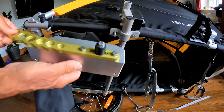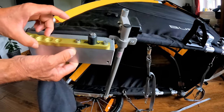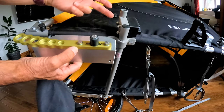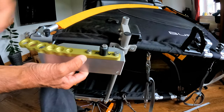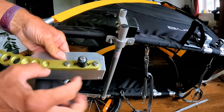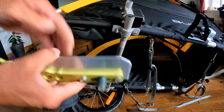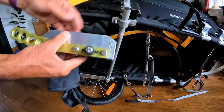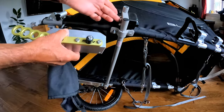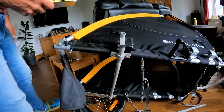We then placed the two units together just roughly by hand and found that this position on the plate works best, and the little bump stop there met the bump stop on the pivoting part, which we'll show you in a minute. And then we just used this painted bracket as a template and drilled the three holes. Those are the two holes there that hold this tilt to the bracket, and that's your bump stop. There you go. We cut some pieces off because that wasn't needed, and this was interfering with those nuts there. So yeah, we'll assemble it and then we'll go from there.